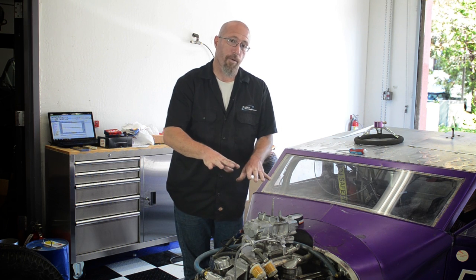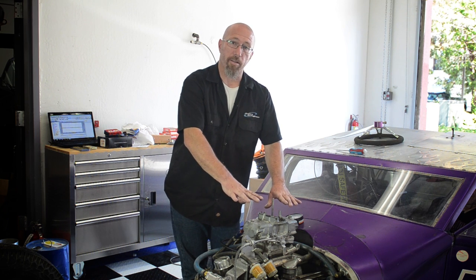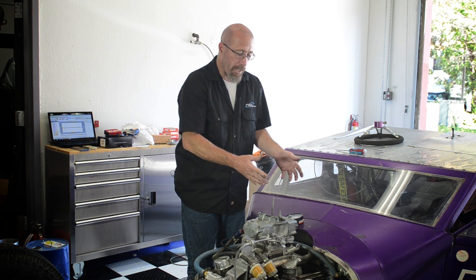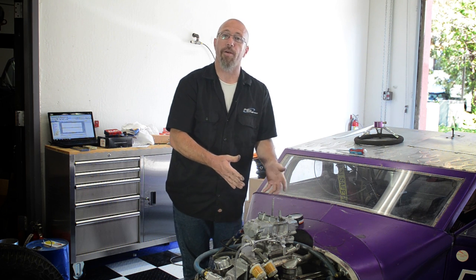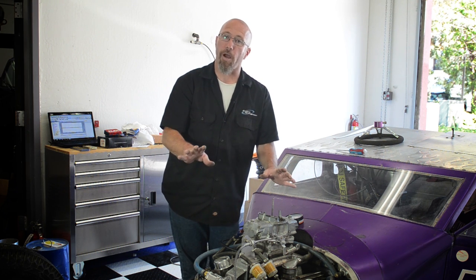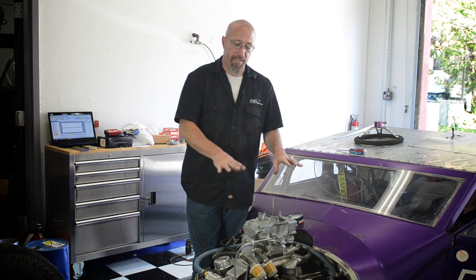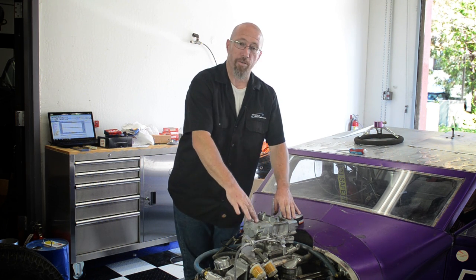Now, after you're done with that, you go ahead and set your idle, and then you'll have to go through this two or three times before the vacuum doesn't change. I went through it three times, and the third time I went through, nothing changed, so I knew I was exactly where I wanted to be. Now we can go on to dyno tuning and see exactly where our carburetor is, and now we'll set our main jets.